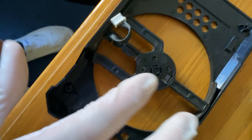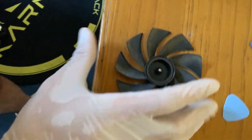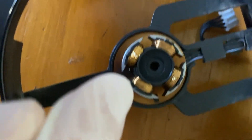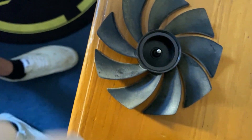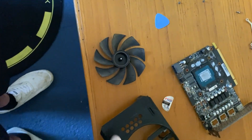It wasn't easy because those things tend to flex and you can damage them, but I managed to separate everything. Now if you look inside, this is our issue — we need to lubricate the pin that goes in there. That's the only point that really needs lubrication, but I'll also spread it around manually. You can see it's dry, so we need to lubricate it again.